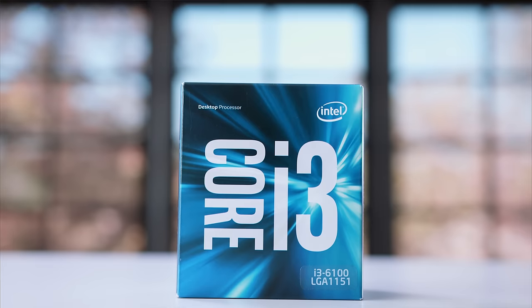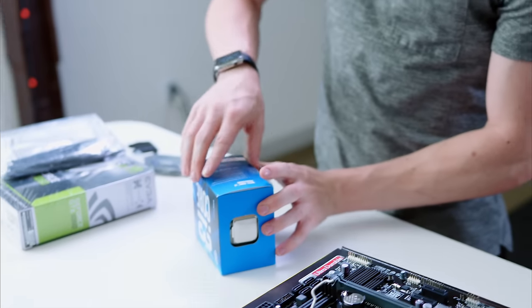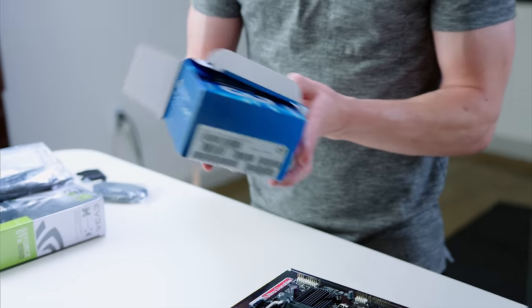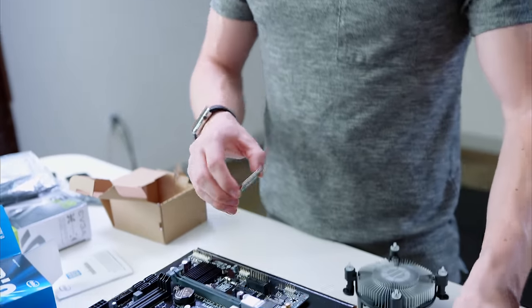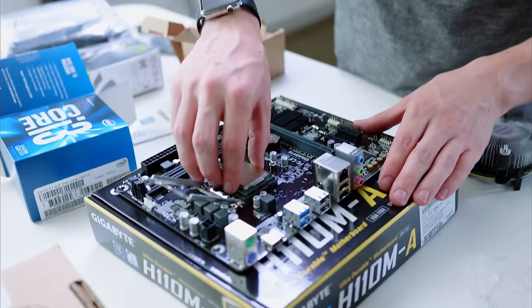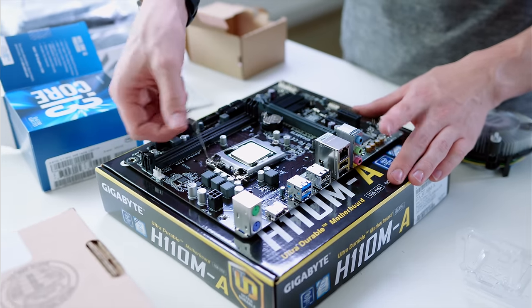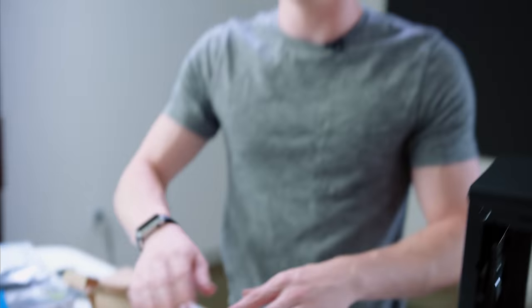Powering the system is an Intel Core i3-6100. I'm actually a pretty big fan of Core i3s for gaming builds, especially on the budget side. While you can go AMD, I like the i3 for the expandability options. Here we have 3.7 gigahertz of raw dual-core hyper-threaded performance. Honestly, this is actually fine for pretty much any game out there. With that hyper-threading, it allows it to act like a quad-core processor, so most any game should run fine. And we're getting it at around 100 bucks, so it's hard to complain.